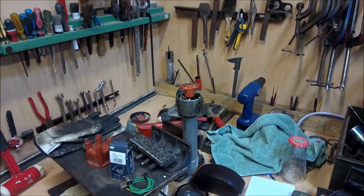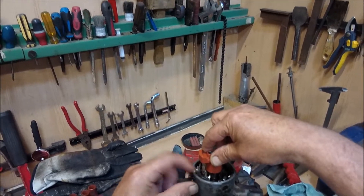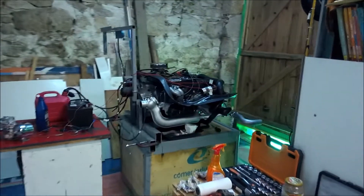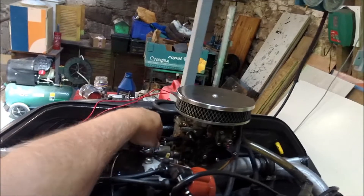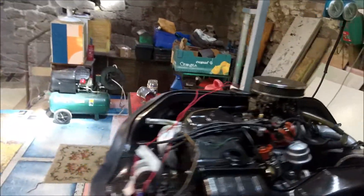So what sort of thing are we going to be replacing? If you have a very early type 1600 Volkswagen or 1200 Beetle and so on, you will have points ignition. Can you see the little points? And we can see that this is what this engine is currently running — points and condenser, SVD, a single vacuum diaphragm advance going into the side. There are lots of bits and pieces here all blocked off, and that is one of the reasons we're fitting an electronic distributor. The coil is just sitting down there for the moment.